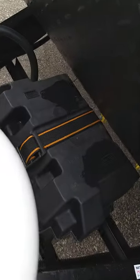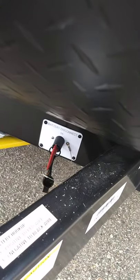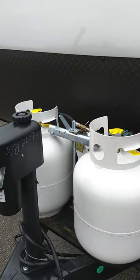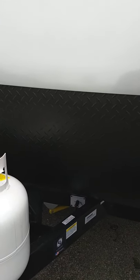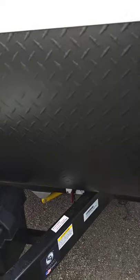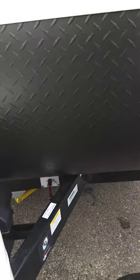There's a deep cycle marine battery and a kill switch for your battery. Right now it's on — turn the key to shut it off. The carbon monoxide and LP gas detector is hardwired to the battery, so even if you shut everything off in the trailer, the safety devices will still draw power. You only shut it off when you put it into storage; otherwise, leave it on.